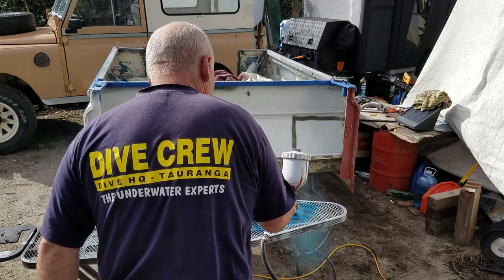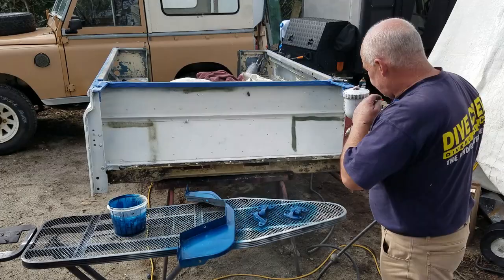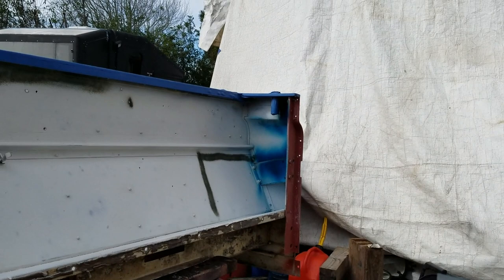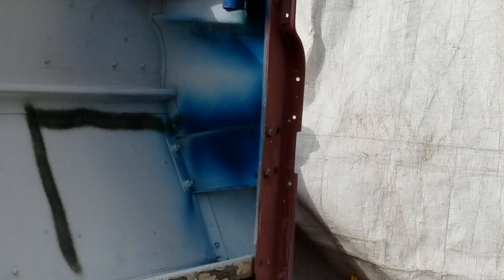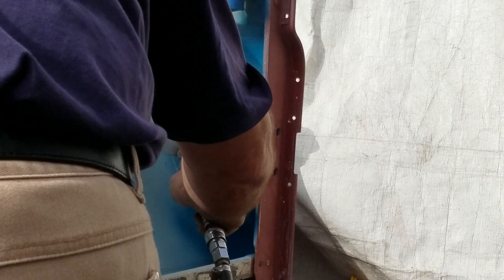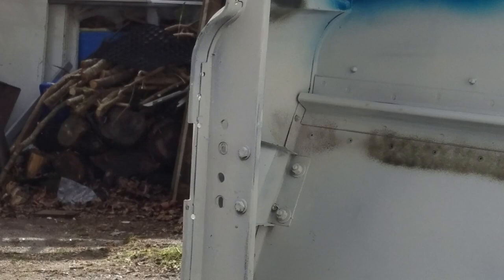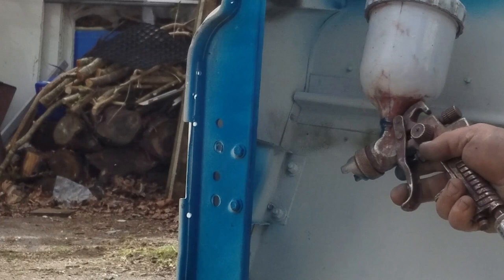Once I've got these small parts painted, I'll pop over to the tub and start painting the most awkward parts first — inside these corners, it's a return, and you've got to hold the gun virtually upside down to get paint in there. If I do it now, it means I'm not going to risk rubbing my knuckles, the gun, or the hose on freshly painted surfaces. A lot of people jump in and start painting an easier bit first, then find they've snookered themselves and can't get into corners like this. The green you can see is where I've just broken through the primer while sanding, so I've sprayed a wisp of etch primer over there to make sure the paint is stuck.